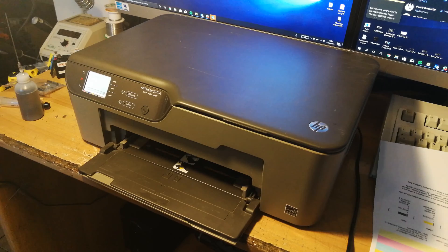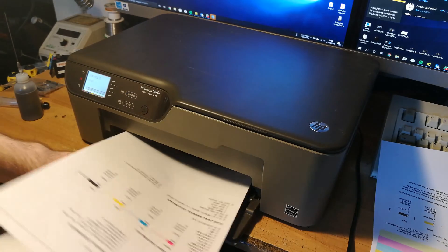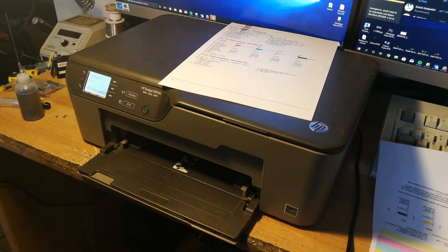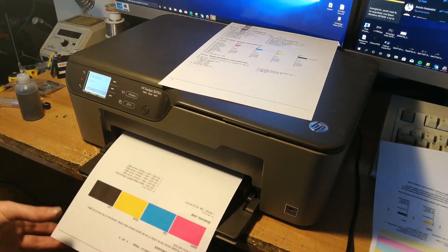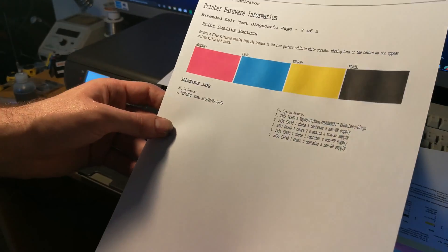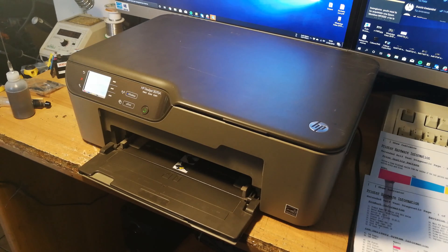From the service menu you can go to special reports and do a standard self test, which may require more than one page. Perfectly fine — this printer is fixed with no problem whatsoever using this method. If you continue to have problems especially with the black, you need to clean the cleaning station. I don't know exactly when I'll release a video about that but it will be soon. Thank you for watching and see you in the next video. Bye.